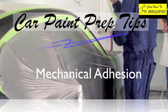And that's the same way with the car. If we didn't sand it, the coatings that we put on top are just going to peel off. So when we sand it, we put those little scratches in it. We provide a mechanical adhesion, and then we have good adhesion. It won't peel on us.